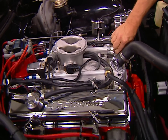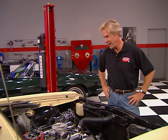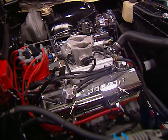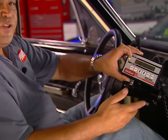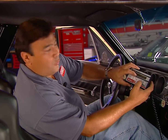After rechecking our connections, topping off the coolant, and reconnecting the battery, I guess we're ready to fire this thing up. Go ahead and crank it, Chuck. Now we can dial in our fuel injection using this handheld controller — it'll help compensate for various engine combinations, and once we get everything set, we'll strap it to the Dynojet and see what kind of power we're making.